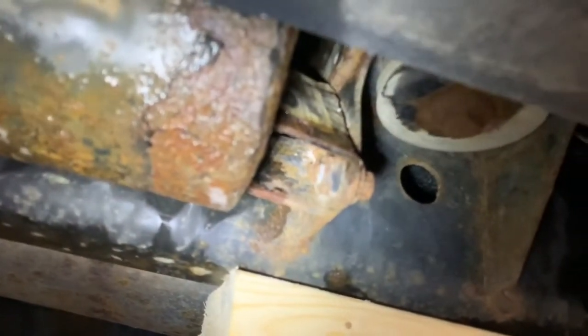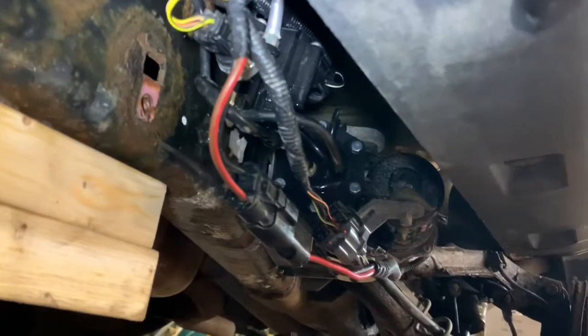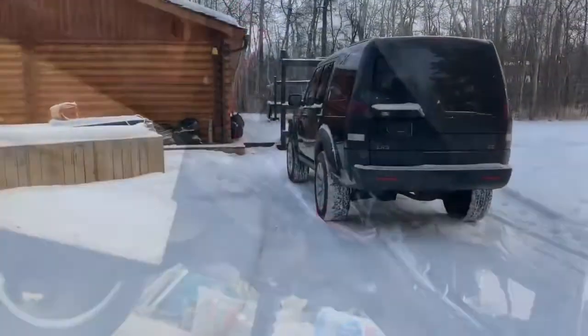But anyway, I found a leak on this pressure valve here on the top. There's that silver fitting there. That was bubbling a little bit, so that made the tank drain slowly overnight, and then the compressor would have to kick on and pump and pump and pump to get this tank back. It's worth noting that none of the shocks leaked, front or back, so this tank was just getting empty and it needed to pump up the pressure again so it's ready. Okay.